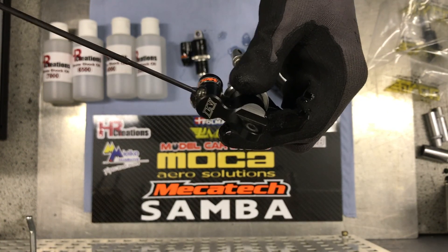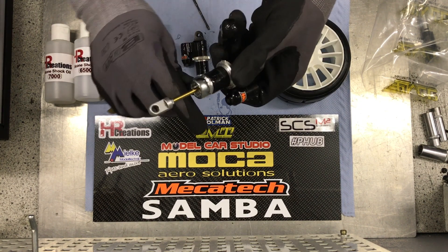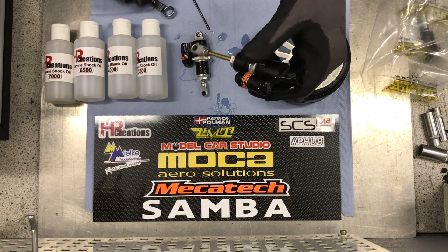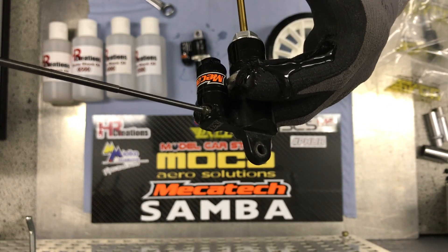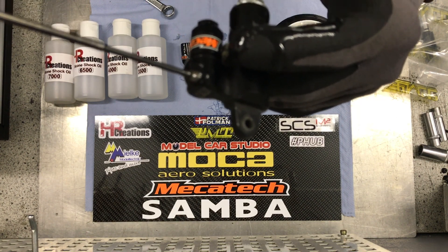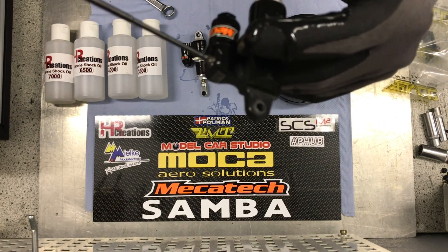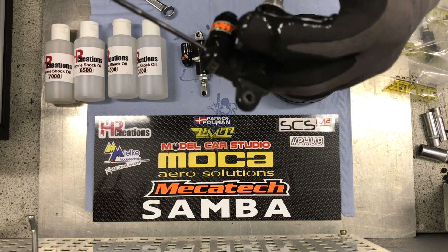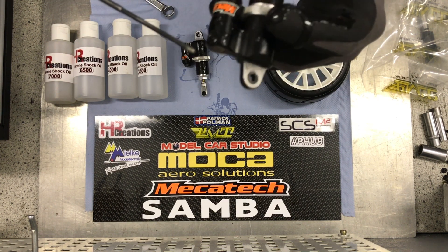Out — like this. Taking it down to pressure zero and closing. Small screw, and now closing the complete shock. Taking out the panel screw again. Be ready to take the shock together. Now move out the piston again, the screw is again free. Just be very careful not to take the piston too fast to the top, because it will maybe push a bit too much oil out and make a small space for air inside the shock.